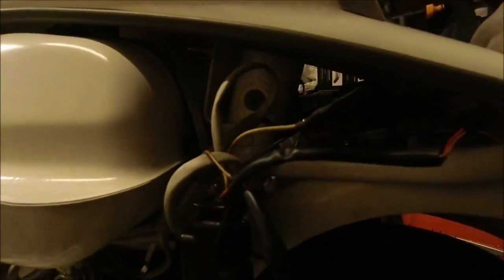So if I can show you, my conversion was to put the solid state rectifier in there, that beast there, original, so I'm running all DC system, and I've got the battery plus and minus through the fuse, so it's more akin to original again. It's got the fuse where my finger is now, 8-amp fuse. Under here is where I've put the black box. One of the problems I had with this system was trying to figure out where the black box could go.